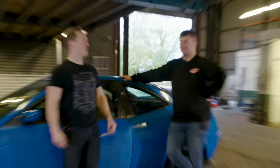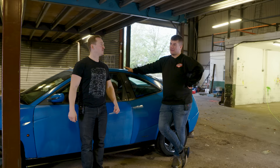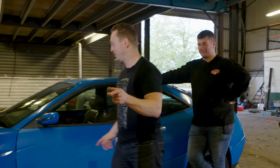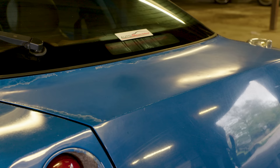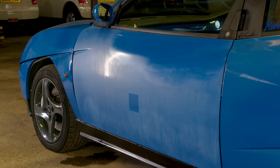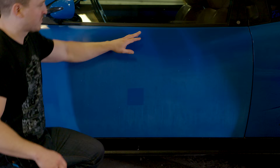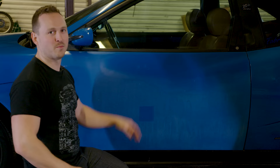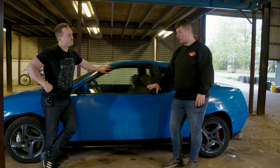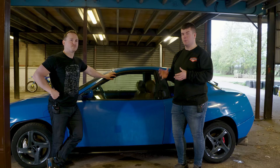How are you feeling about this? I'm actually quite excited because for once I actually want to try and do something properly and see if we can make it look really nice. There are no caravans in this video, there's going to be no smashing up of anything. If we have a quick look around, you haven't seen in detail how bad the paintwork actually is. So if you have a look at this door — completely faded. We've done a bit of a test polish here and up close it's not good. A lot of the paint came off on the pad, which suggests it's solid paint and it hasn't been lacquered, which would suggest it's original paint because I believe this car wouldn't have come from factory with lacquer on it.